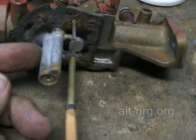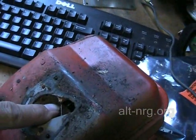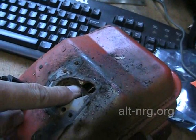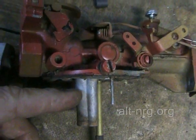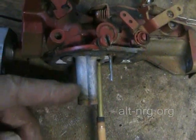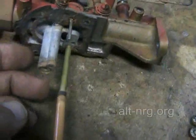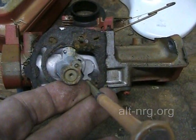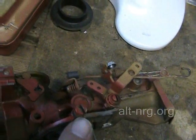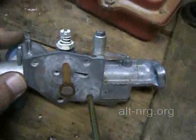Now the most important difference is the fuel pickup. Notice at the bottom of this carburetor the fuel pickup sat inside the gas tank. Here is the top of the gas tank and here's that little chamber — this is a spillover right here. So the level of the fuel is the distance from the top of the gas tank to the edge of this spillover, meaning fuel in the carburetor would normally rise to about here. The pickup is immersed in fuel constantly regulated to about that depth. Inside the pickup you see the fixed jet, which sets the run mixture of this carburetor, and this screw right here is the idle adjustment mixture.